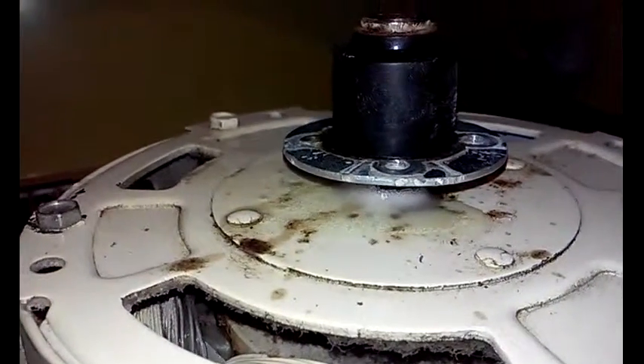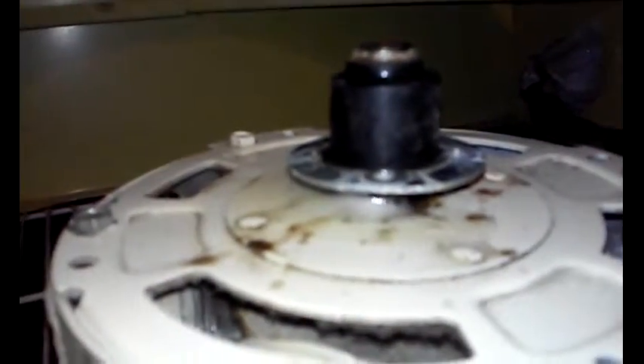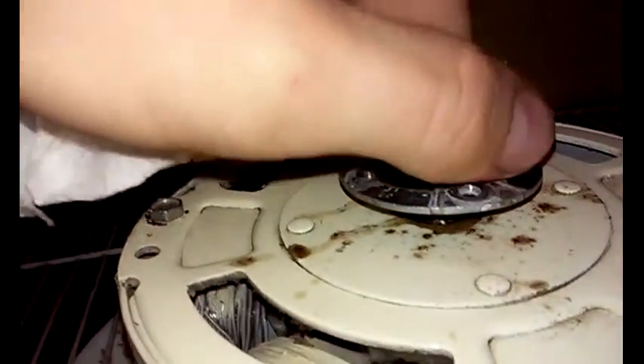Now I'm going to squirt a little more. Just like with the back, I'm going to do it three or four times. Just going to do it one more time here. All the oil is going in there nicely. Wipe off all the extra. When you're doing this on this model of fan, it's important not to get oil right here because this is all rubber. The way this fan works, this part that you screw into doesn't actually hold the blade — this rubber is what gives it traction. You can see this is almost completely jammed because it just hasn't been running that well lately.